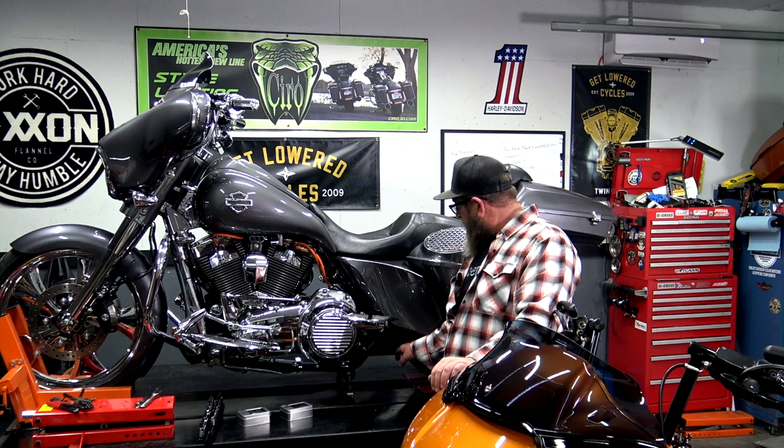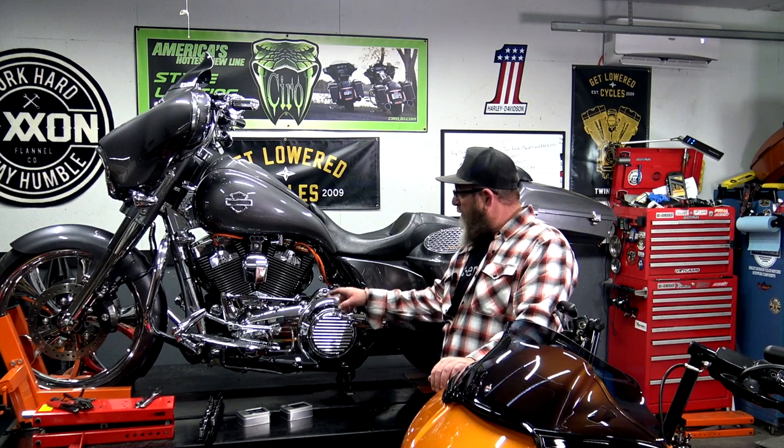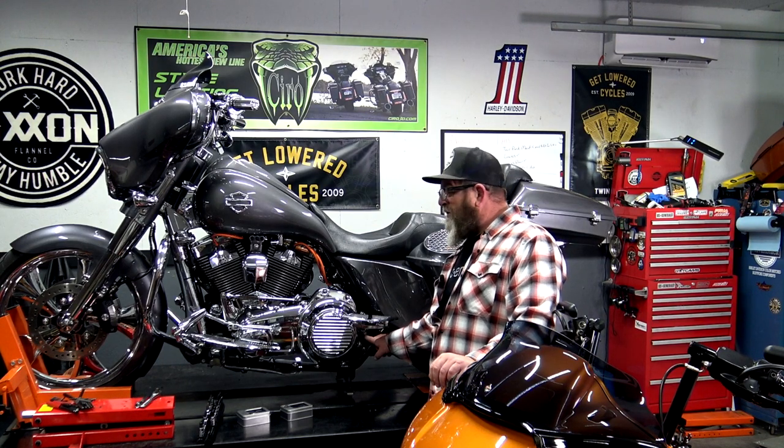Getting some chrome down in here is something I've neglected — like the lower belt guard, brake calipers, stuff like that right below your floorboard. Right on top of the swing arm you've got a plastic swing arm cover. The plastic on there is junk — Harley puts that plastic cover on there, it just pops on, it's not sealed. I can tell you this for a fact because I've taken a few swing arms out. When water gets down in there, especially if you live in high humidity areas or ride in the rain, it rusts that swing arm bolt and nut, and that is a pain to get out when it's rusted.